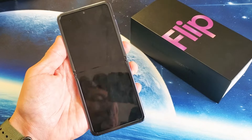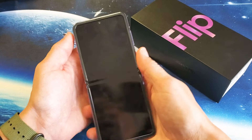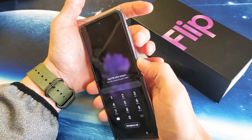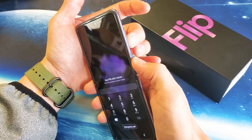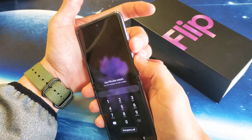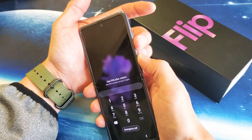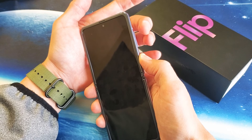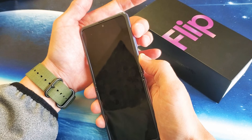Very, very simple. To bypass that password and get into the Android recovery menu, we're going to press and hold two buttons: the volume down and the power button. Wait until about 15 seconds, right before your phone is about to reboot, then let go of the volume down button and press and hold the volume up button.